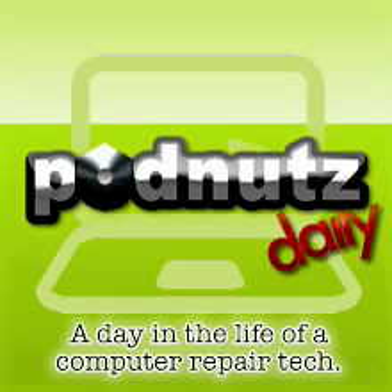I was in there trying to figure out what the problem was, switching out processors. I switched out the processor and I didn't put the full heat sink on this time — just a small heat sink with hand pressure. I didn't put the whole computer back together to test it. I tried it and it ran for one second instead of five seconds. So I knew the processor was the problem, because with the original processor it was running five to ten seconds, but holding the new one by hand with the small heat sink, it ran for just one second. So I knew this thing needs a major heat sink and a lot of cooling because it gets hot in a split second.